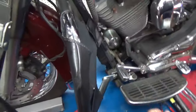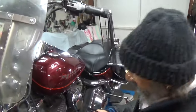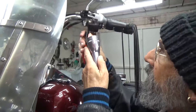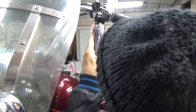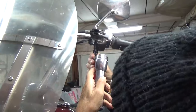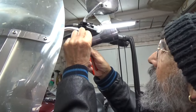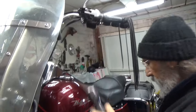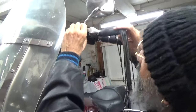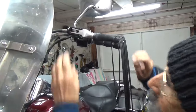I backed off on the cable adjustment entirely. What I'm going to do is take the lever off and lube it. Let's start by getting the pin out of there. It is important to do a good job right there — you drop this little clip and you may never, ever see it again. I have a whole package of them somewhere because I've dropped a lot of them. I just don't ever remember where that package is.